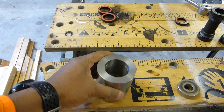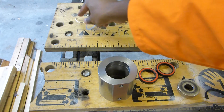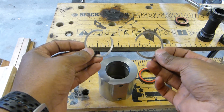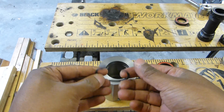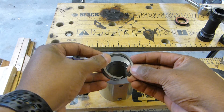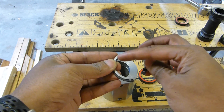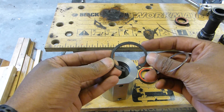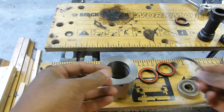To install the system into the bottom bracket shell, you have two bearings and two snap rings. Now these snap rings are actually quite important. These are genuine snap rings, they're Smalley snap rings and they fit really well. However, there are some people that use this type of snap ring and that is not really designed for this system. If you just overlay the two together, you can see that at the periphery the Smalley ring is fairly constant in radius, but the external snap ring or circlip is much thicker there than it is around the sides, and that can actually impinge the bearing, so that's something to avoid.